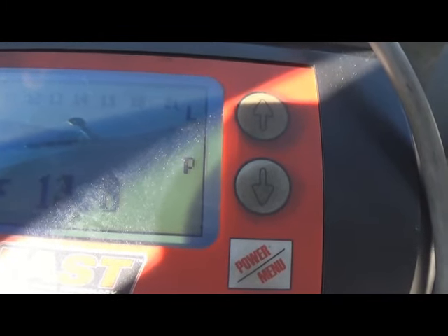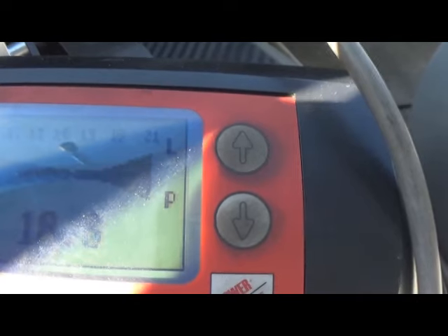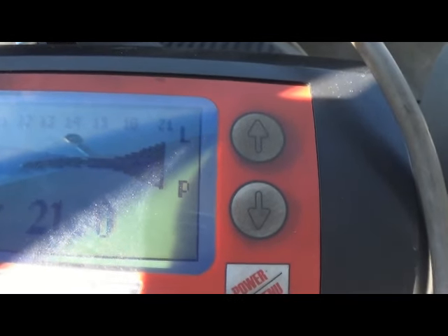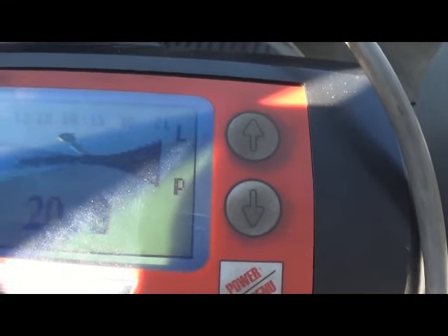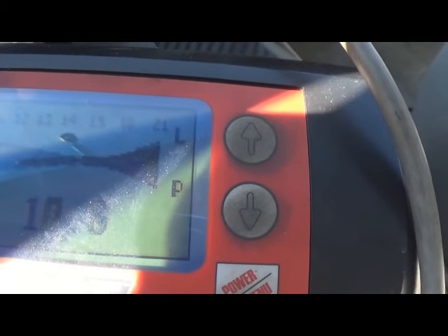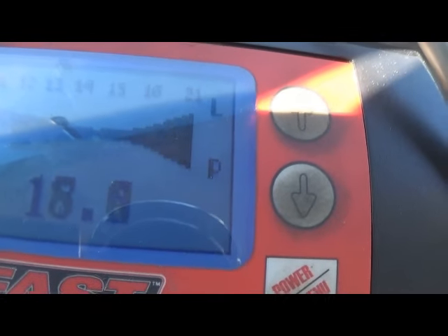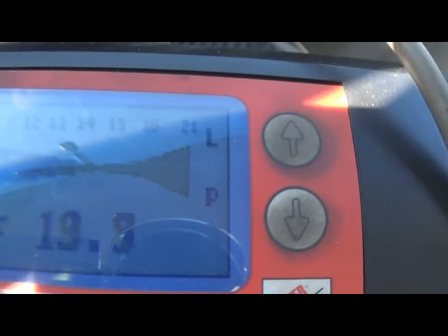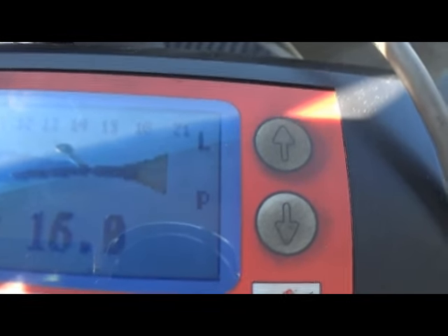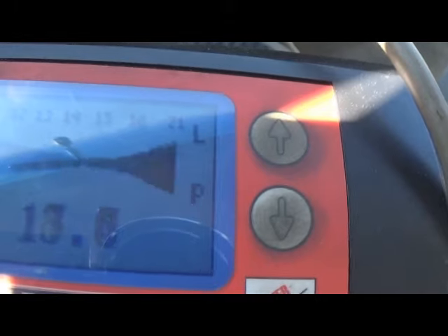You'll get to the point where you know when to tap the gas pedal — we're going to tap it now to get it off fast idle. Now it's idling a little lean, so you might have wanted to leave it on the fast idle a little bit longer. But as you can see, it still ran — I haven't touched the gas pedal except when I blipped it. And naturally with the O2, you can see exactly what it's doing so you can fine tune it.